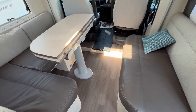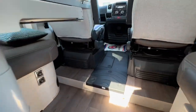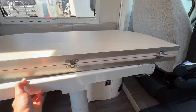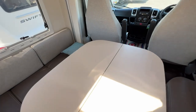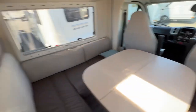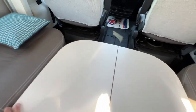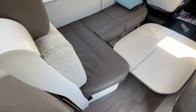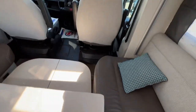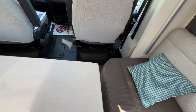To make the occasional bed from the lounge sofas, make sure your table is like this. You can spin the table around using the handle by pressing it - but always want the hinges to be this side. Pull the extension out, push it as far over as possible, then drop the table down into position using the switch. This fills the void. Then use the infill cushions - the one with the shaped edge goes here and the one that's square goes into there - and you've created a double bed.